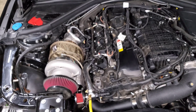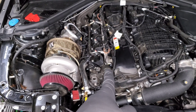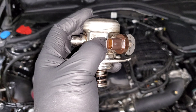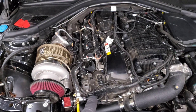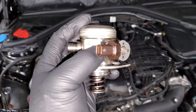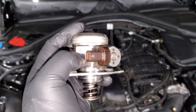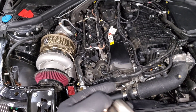It works in conjunction with the pressure sensor. When it sees that the pressure is getting too high, this sensor restricts how much fuel is going through the fuel pump to reduce pressure. In the opposite way, if it sees pressure is too low, this sensor will open up the fuel flow so that more fuel can get into the high pressure fuel system.